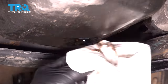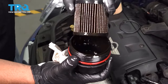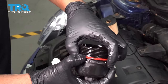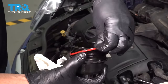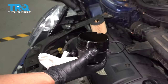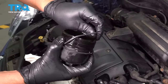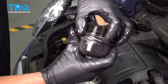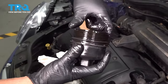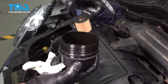Take a rag and wipe any excess. Now take the old filter out of the cap and remove this seal — you can use a pick if you need to, but if you just squeeze it together it normally works. Take that off and put the new seal on.